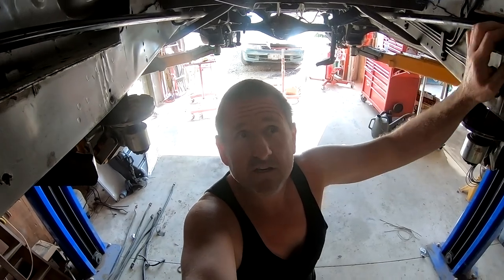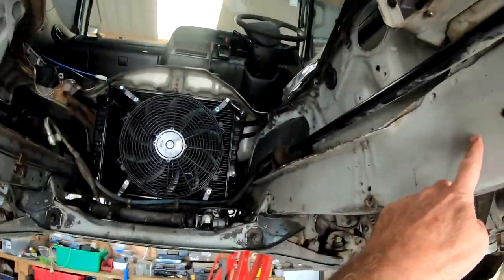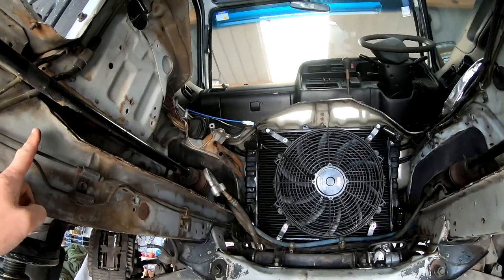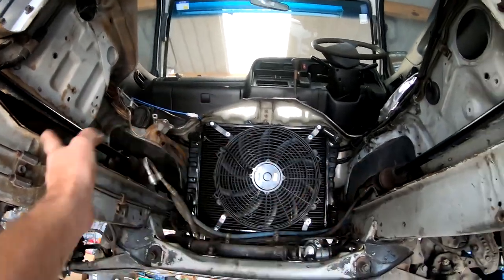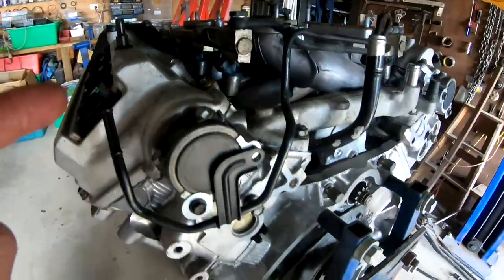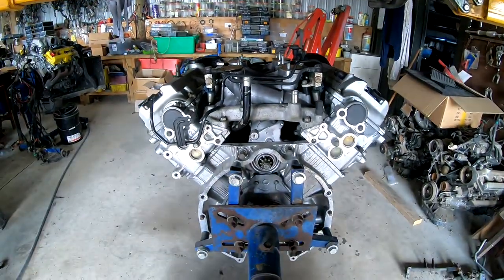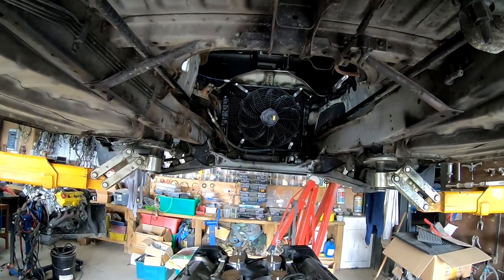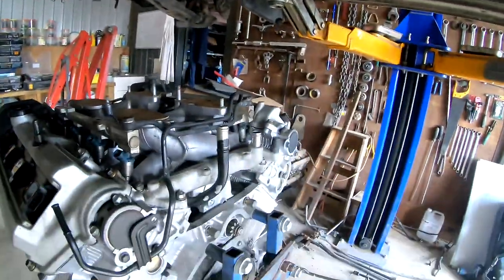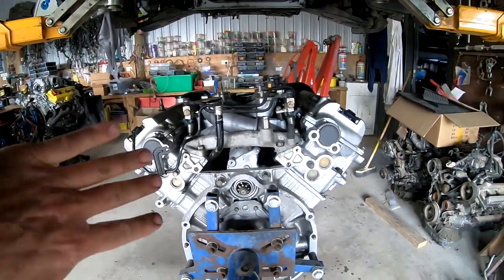I think it's ready to have an engine put in now. If we actually have a look at the chassis rails between here and here, it's about 20 millimeters narrower than the engine — so there's a big engine going into a little hole, which is going to be interesting. We're actually going to turn the engine sideways so it will fit through the hole; we have to rotate it on the engine stand sideways.